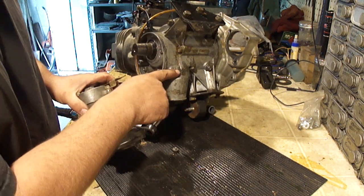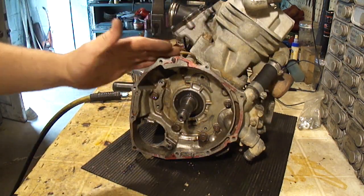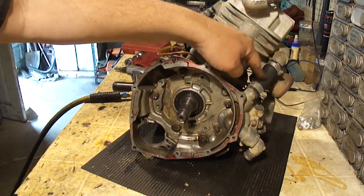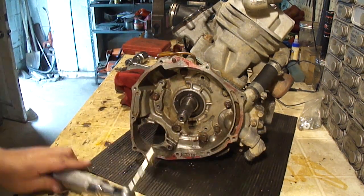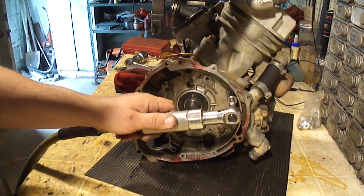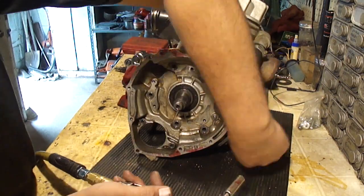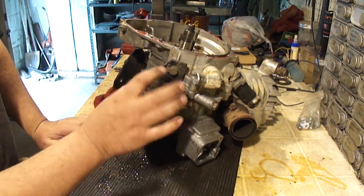There's the starter — you can see there's water in the starter, and this is a problem that these older Polaris have. Not only that, but I did break a bolt right there. The next thing I'm gonna do is take this outer cover off. There are some 12 millimeters and some 10 millimeters in here, plus you gotta take this hose off. There's also some 10 millimeters around this outside. There's one longer one that came out of that hole right there.